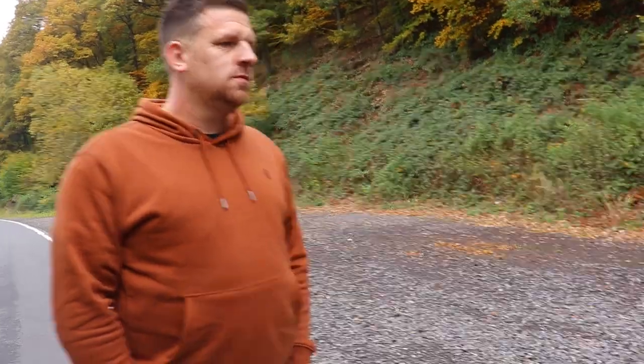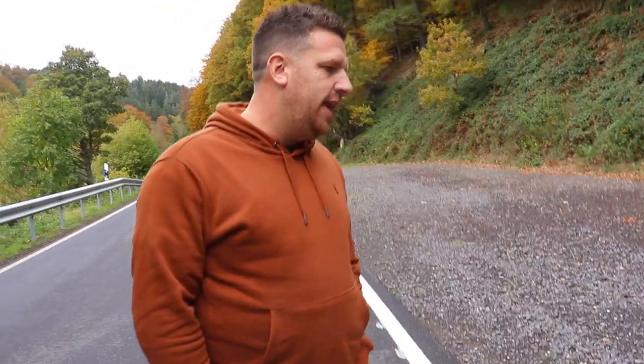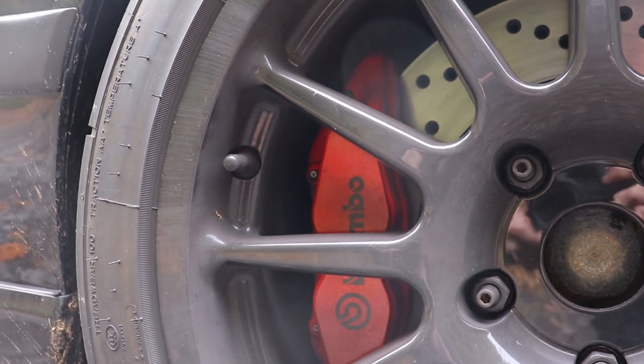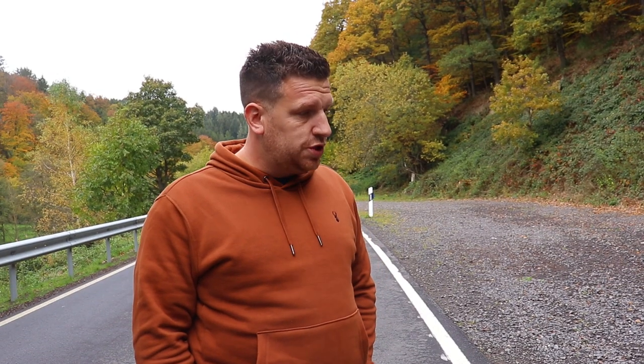And when we look at the brakes, those are not stock anymore. They look a bit odd for an E36. So for the brake kit, I decided to go my own route. I knew the calipers, the Brembo Megane R26, so they are Megane calipers? Yeah, it's a 265 caliper. I sourced them and M3 CSL discs, and I had some custom adapters made up. So they are big brakes for a big price. They're a 345 disc.